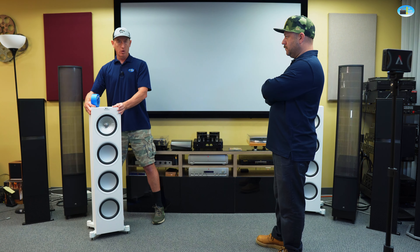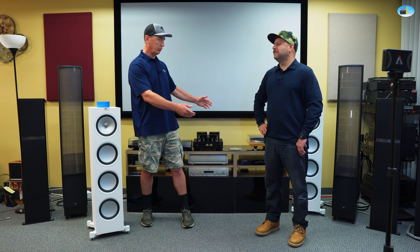You can't put the tower speaker on top of grandpa's chair, or one speaker ends up over there and one's right here — so if the speakers end up wider, that's fine. When you toe them in you might notice the image is a little more focused. The idea behind this is when the speakers are set up properly that way, it'll literally sound like vocals are coming right from the center. It's kind of magic — there's no speaker there, so why is it producing sound?